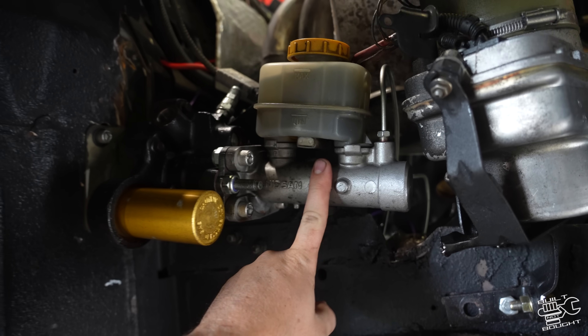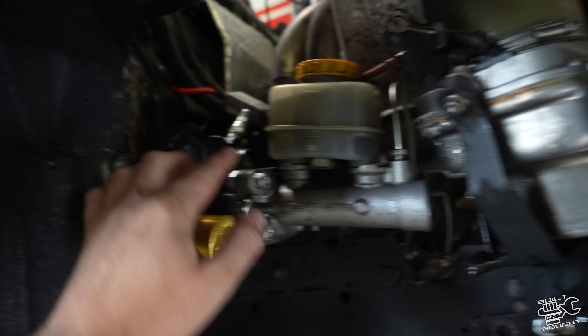I'm going to start with pulling this front off. The three major things that everyone probably heard about at the shows was it moving, stopping, and running properly. We got it moving — we got a drive shaft — but we haven't got it stopping yet. This is that hydraulic booster we were talking about. The brakes are in, the brakes have bled, they're fine. It's just this booster. We couldn't use a vacuum booster — we didn't have the room there with those headers, and being supercharged with turbos you're not always getting vacuum anyway, so I went with the hydraulic option. That should be fixed soon — we're just waiting on an extra hose to hopefully fix that.